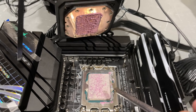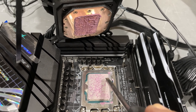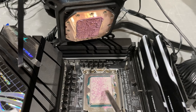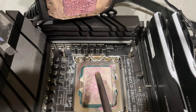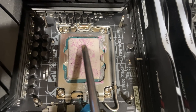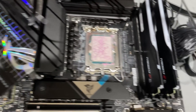So here on the stock ILM, mine isn't so much pooling in the center where the latch is, but there's definitely more paste in kind of exactly where the die would be — kind of in the center from top to bottom here. So that's how you can kind of tell that it's not flat — the paste is not even across the whole thing. The center up and down does have a little bit of a groove in it. So now let's take this thing off and put on this bad boy.